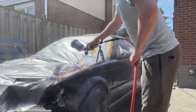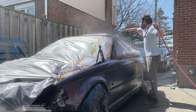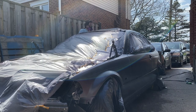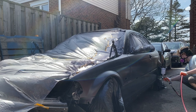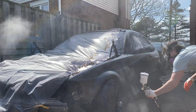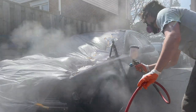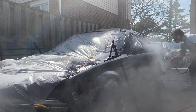Painting the body went pretty well. I didn't think my compressor was going to be up to the task, but it handled it pretty decently — the paint laid out smooth and everything was starting to look like it was coming together. The clearcoat is where it got away from me a little bit. I thought I was laying it out pretty good, but I ended up getting a ton of runs on this side of the car, mainly because I was using a new clear that said to use 50 psi when I was using like 30 psi beforehand. I tried to lay it on thick and those combinations just did not work at all — this entire side of the car will pretty much have to get redone later.